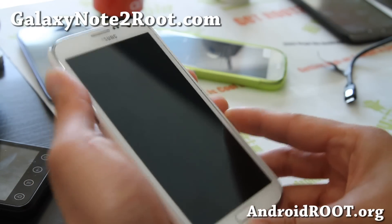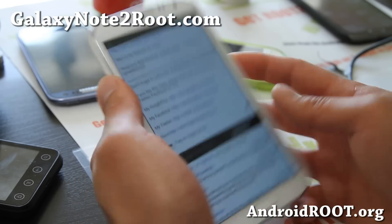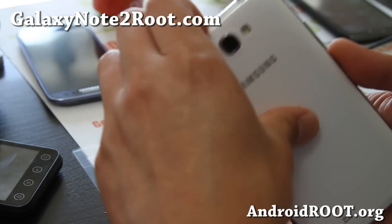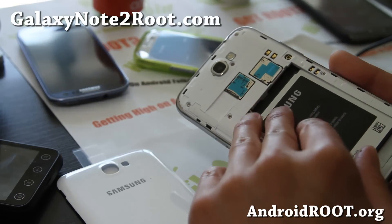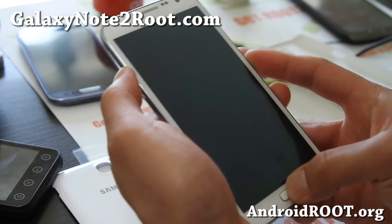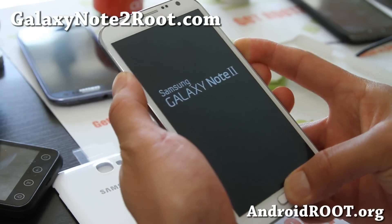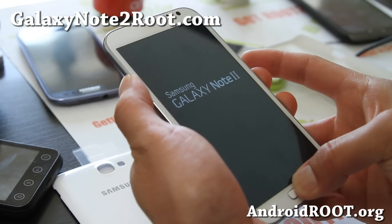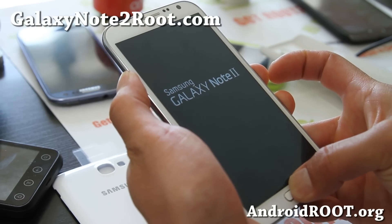The first thing you'll want to do — if you're in a boot loop or whatever — take the battery out and put it back in. If you're in a boot loop and need to unbrick your phone, immediately hold down volume down, center home, and the power button. Your phone will power up, and when you see the logo, keep holding volume down and center but let go of the power button.